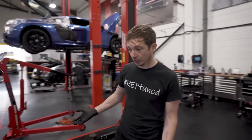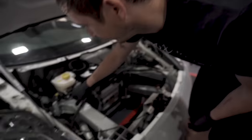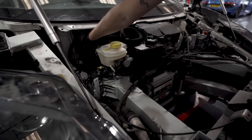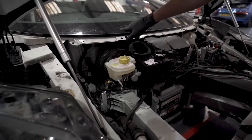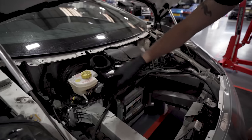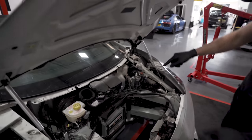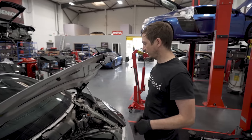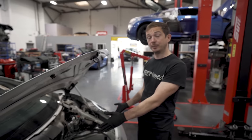You can see we've got all the front end stripped off. We're going to come off the reservoir — the pipe's going to go through that hole there, into the clutch cylinder. Then it comes out of the clutch cylinder; the metal pipe goes up over the diff, runs all the way down the prop tunnel, all the way out the back of the car, and then loops around onto the bottom of the gearbox. That's why we've got this bit out.